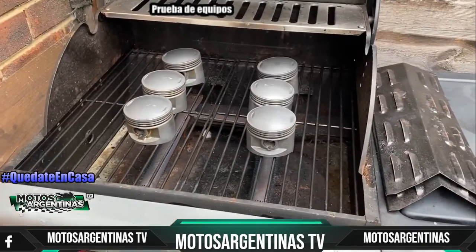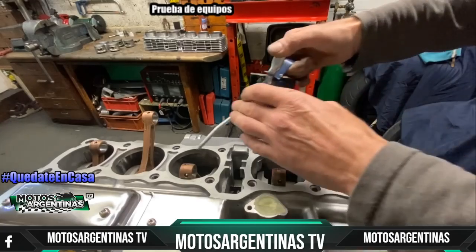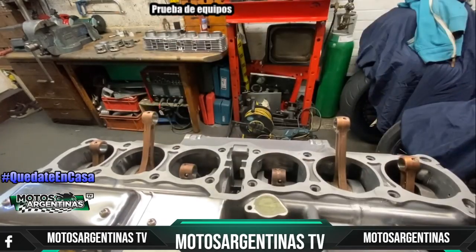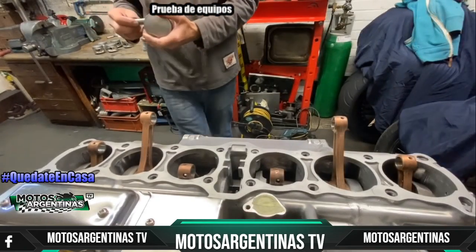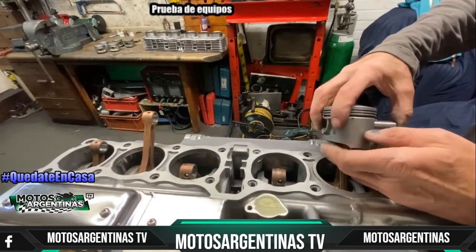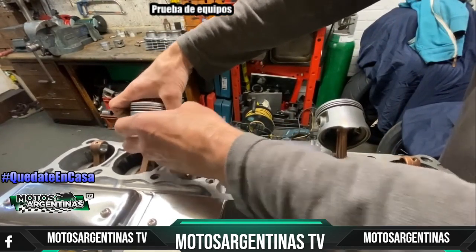I then place the 6 pistons in the barbecue just to warm up a little bit to allow the gudgeon pins to slide in easily. While they're warming up, I put a bit of oil on each little end bearing, just to help the gudgeon pins slide through. With the pistons all warm from the barbecue, the gudgeon pins slide in easily. I'm fitting them to the engine temporarily just to check that the barrels will fit. I won't be fitting rings at this stage.